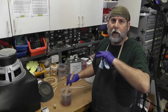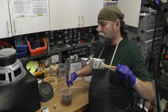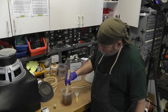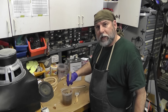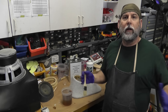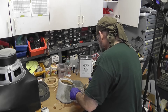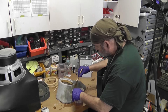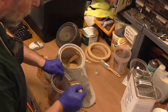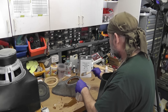I buy loads of cheap paintbrushes — maybe twenty for five or nine dollars — you throw them away when you're done. The color has changed: it's no longer reddish pink, it's becoming clear with just a hint of a red overtone in the center. We're going to soak the material so there's no air left in it. What I'm really trying to do is use the paintbrush just to convey a mass of resin to the material. You'll see me chase the light spots. It doesn't hurt to try and brush the fibers flat — less sanding for later.